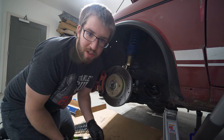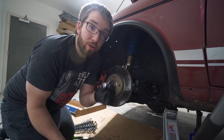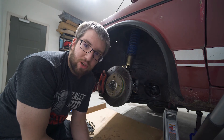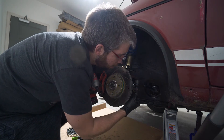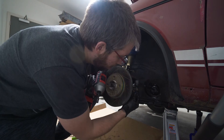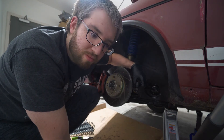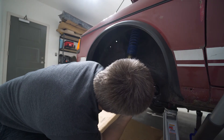The folks at FCP Euro actually provided a proper nut for a cotter pin, which I didn't have before - it helps prevent it from spinning off. Everything seems to be in even numbers here, trying to figure out if these are standard or metric. It's on 18 - the 19 feels big - okay it's a 19. Hopefully it didn't go too tight. No grease came out, which is good. Cotter pin in for safety.